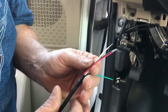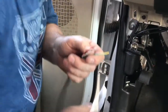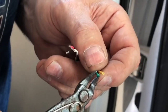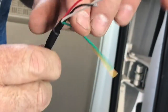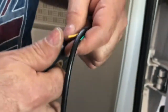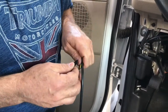According to the instructions, the green and yellow wires are not used. So what I did was cut the tinned wire portion off these wires. I'll cut one a little bit shorter than the other, and then we'll just put this back against the harness and tape it up so that the wires don't touch anything underneath the dash.